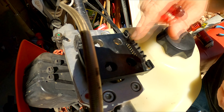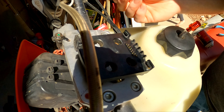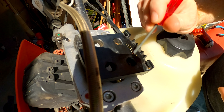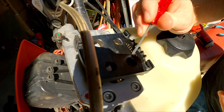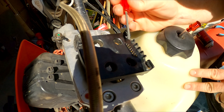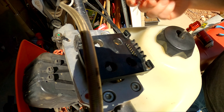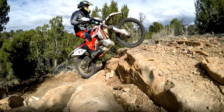And that right there should be just fine. My pins stick up, and when I put the unit in after a while it's going to press that down and grease will slowly ooze out over time — but it's fixed, and it's a cheap fix once you have another mount to replace pins from. I can't guarantee that if you had the Garmin Voyager Pro you could pop out the Garmin unit — I don't think theirs had a rubber seal. If like on this bike you're not doing any of the sensor stuff, you could figure out what other pin to sacrifice and just pull out and replace. This is the easiest way, and now I have another mount for the new bike that's coming.